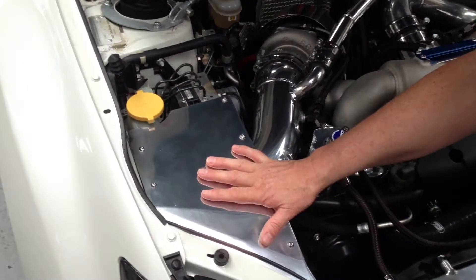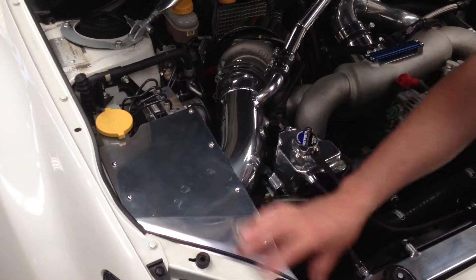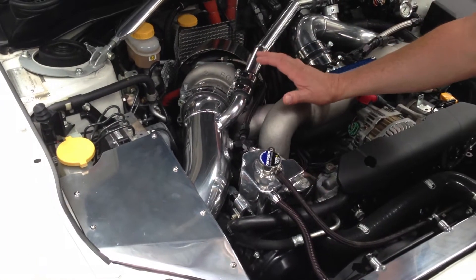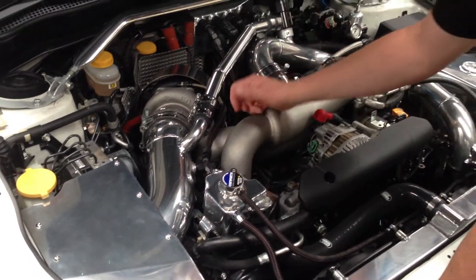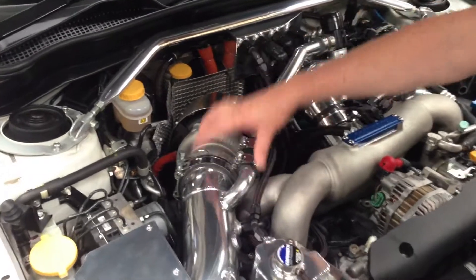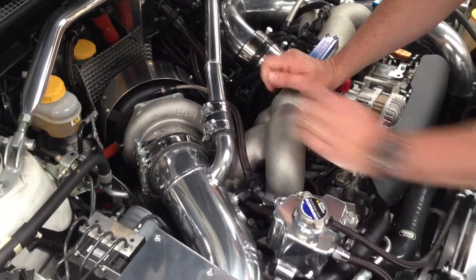This particular part here is a custom air box assembly with an air filter inside it to heat shield the intake from the turbo, plus also to reduce the risk of defects, although on this car it's probably a little bit ironic. You can see the ginormous turbo assembly here, which is angle-mounted because the intake won't fit under the inlet manifold like the factory standard turbo does.